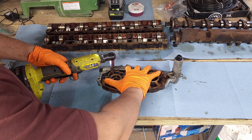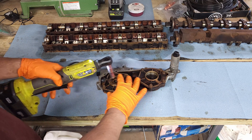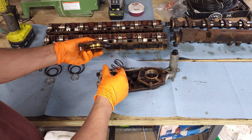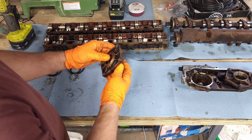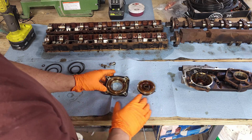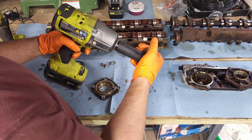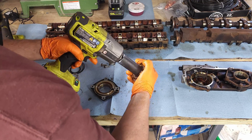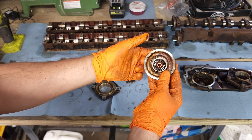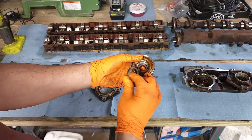We're going to take these off one at a time, we'll start with this side. This is the side that has the spring in the bottom of it. I'm going to clean these up a little bit before I break them open. Separate this part - maybe one anti-ugga-dugga. Some of the other higher end kits come with new bearings for all these, but I'm just going to be replacing the anti-rattle ring, which is the second to last piece. There's one more washer in here - I'll leave that alone.